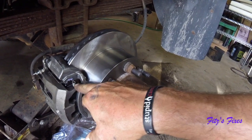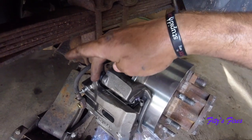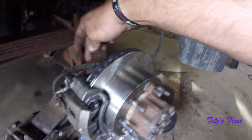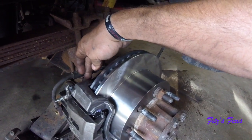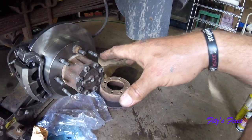So it's pretty much feel to get those down to where it doesn't leak anymore. Remember a little bit of grease behind these where the pads slide in and out, so that you don't have any binding. And these sides have to have the flat spot go along there. And then those guys in the back there, these 18mm bolts, I'll torque those real quick. Everything is cleaned off. It is ready for the tire, and then that's it.